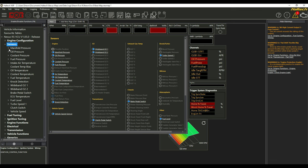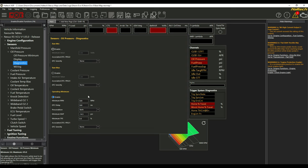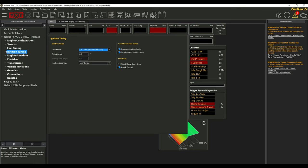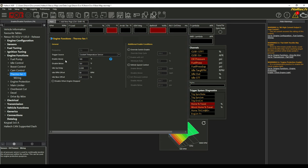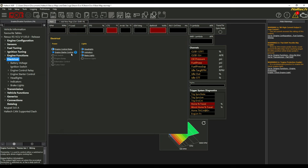Going into the sensors section from the main menu, you can select all the sensors you're going to run, one by one. For oil pressure, you download the calibration for the specific sensor you're using, set minimum pressure at different RPMs, minimum and maximum warnings, and set up safeties. For the wiring, this one's using AVI9 — you go in, edit, and select any available wire. For fan control, you select when it will enable and disable based on temperatures, and you need to use a 25-amp output — one of the four available for the thermal fan.